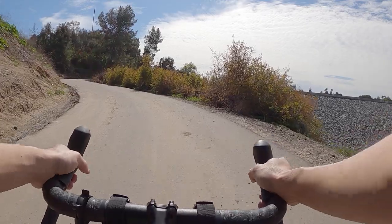However, with a head tube angle of 72 degrees, short-ish chainstays at 422mm, and a pretty low trail figure of 59 — again on a size 56 — it's certainly not claiming to be a stable, plow-through-the-chunk kind of adventure bike.